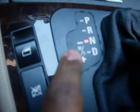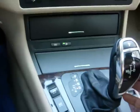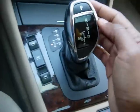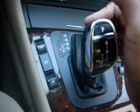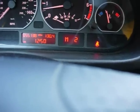Once you switch that, your 2001 or older E46 BMW will shift the way this plate and this knob demonstrate. I'll just do that real quick. I'm going to shift the car into drive, then into sport mode, and go into manual mode. I'll go back one — that's second gear. Going back again — and it's going up to third. The car is correcting itself, actually.